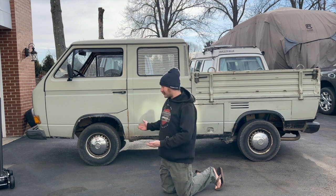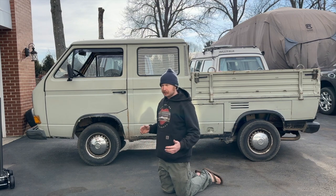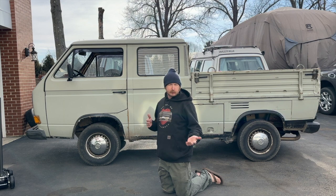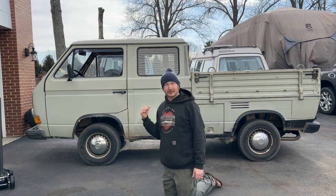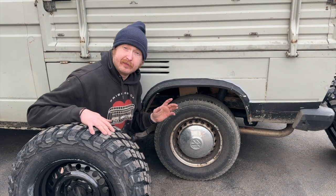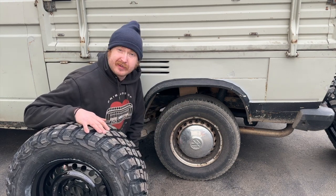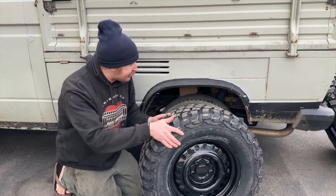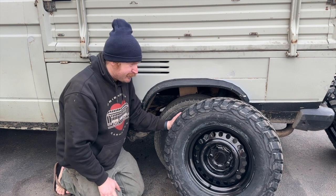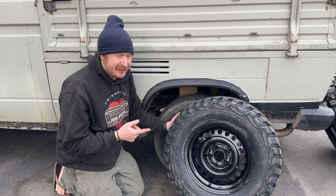It's time to make the truck look cooler with some giant tires and a lift kit. We're adding BF Goodrich mud terrain tires on Go Westy 15-inch rims and a Go Westy zero lift spring kit. The zero lift springs on a lighter truck should lift it about an inch to an inch and a half. Vanagons came factory equipped with 14-inch wheels and generally some really small light truck tires — in this case Bridgestone Blizzaks, which are actually pretty good snow tires. But we want to make some irresponsible choices and add a couple inches of additional meat, which is going to profoundly affect the gearing and reduce the horsepower, but make the car look way cooler.